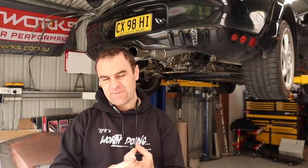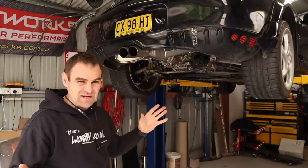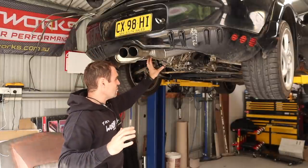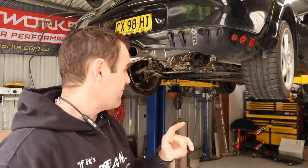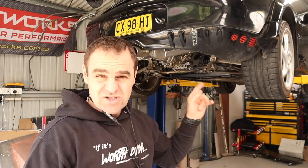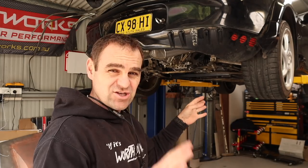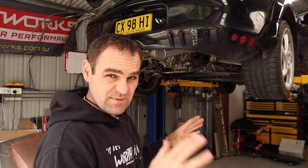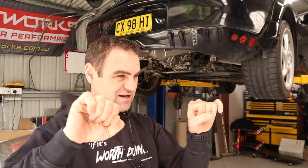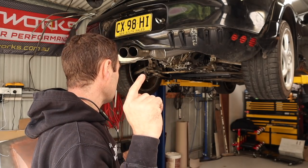Another quick test drive done, and you can see from the GoPro footage it's not definitive. The subframe doesn't look like it's moving at all. The GoPro is obviously shaking a little bit, but it does look like the engine is moving slightly. I might have to mount the GoPro further up watching the engine mounts, put it in another location and try again. From the back there's not a lot of movement. It was also more prevalent when I touched the brakes, so it could be the brakes are twisting, but I'm pretty sure it's on and off the throttle. We can try starting the engine while it's on the hoist and just rev it to see how much the engine moves. It looks like the engine moves a bit when you give it a rev, so I may need to beef up those engine mounts — there was a little bit of slop in the holes for the bolts, which I wasn't happy with at the time. That's an easy fix.